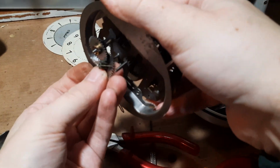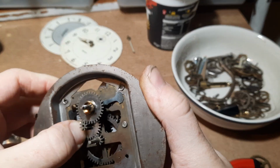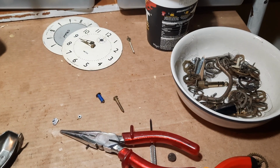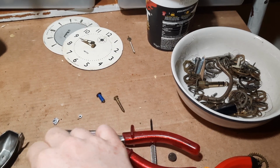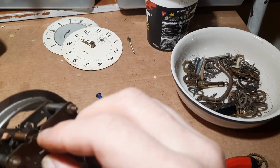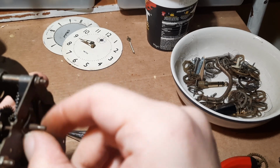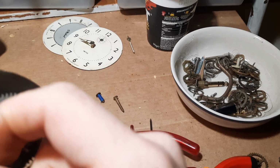This all does this. So I'll put this back on. And if the hour pipe's still attached to the face, then don't worry about it, because that can be worked around. It's probably easier to do that actually. But now that circlip's in there, there is a clip like this, which goes around that top hole. If you put it on sideways like this first, slot it in, and then you can rotate it around, it's much easier than trying to squeeze it down whilst putting it on.